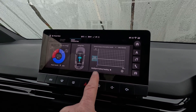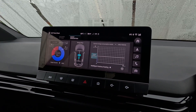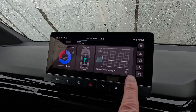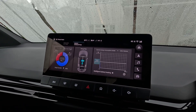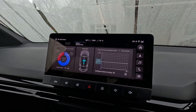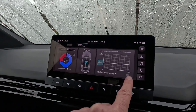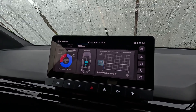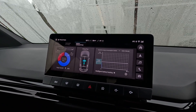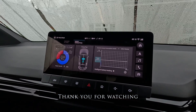The other thing that's very useful is the intelligent battery heating switch, which is only really useful for when you're plugged in and charging and you want the battery warmed up before you leave — when it's sub 10 degrees, that comes on the heating. Or if you're approaching a rapid charger and you want the battery warmed up to get the fastest possible charge. So you need to be aware of this: if your car is giving you much less range than you expect, have a check on here under energy consumption in the battery controls, and make sure your intelligent battery heating is switched off, because it uses up to 7 kilowatts to heat the battery — and 7 kilowatts is about 28 miles of range per hour that it will use. You don't want to lose that power if you can help it.